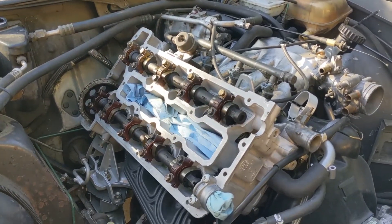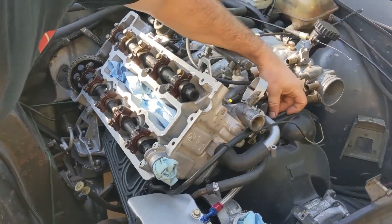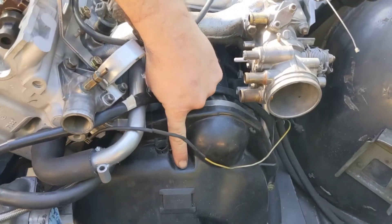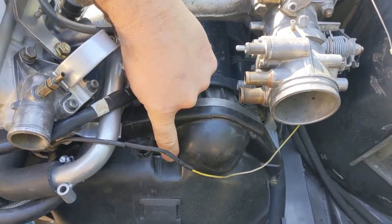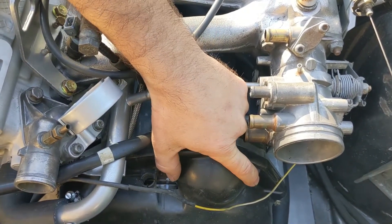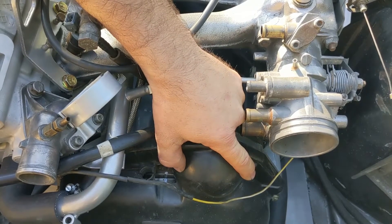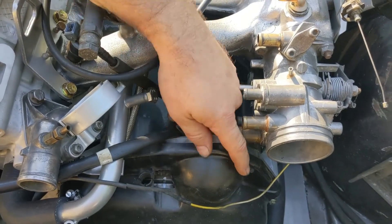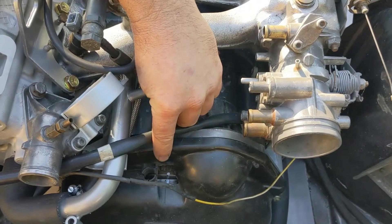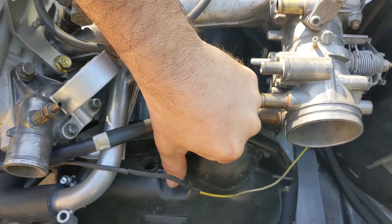The first step that needs to be done - and this is critical - is coming around here to see the mark on the clutch cover that lines up with TDC on the flywheel. On this particular car, the flywheel is lightened, so the normal timing marks aren't there. Instead, I've marked top dead center with some white paint, which is actually a helpful idea in general. Those lines need to stay lined up throughout this whole procedure.